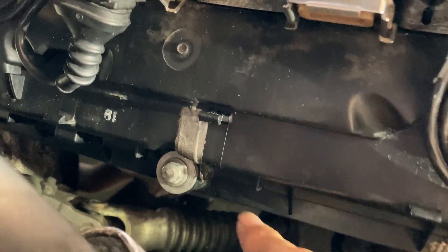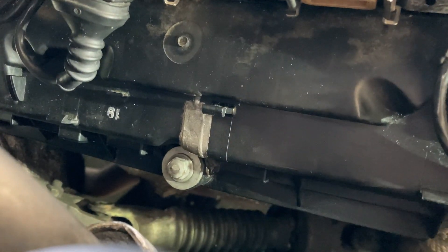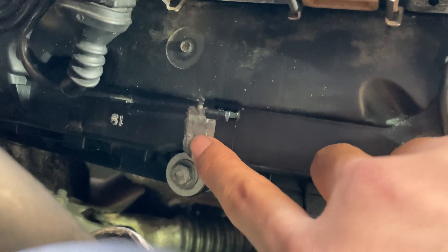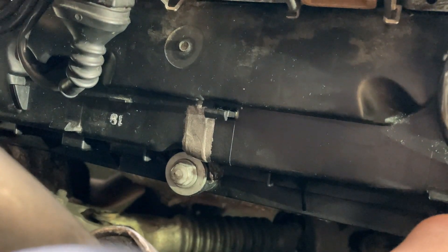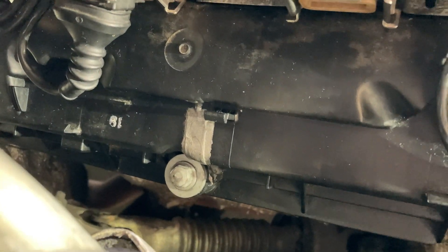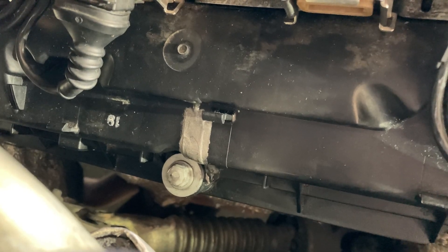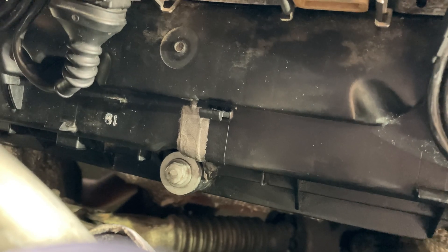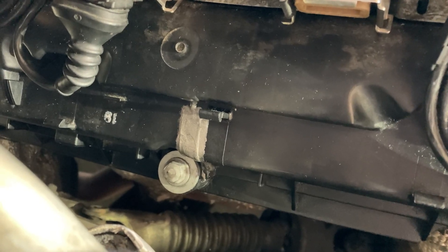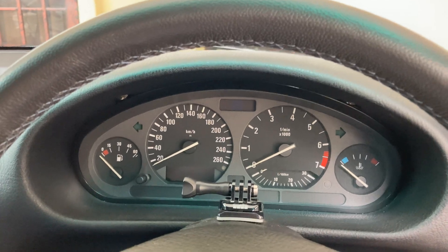This is the outcome — I tried to do it as neat as I can. The crack developed from near about here all the way down to the rim. I've just bolted the valve cover back and so far there's no crack that redeveloped because of the bolt, which is good. The texture of the epoxy is soft, pretty soft — I can feel it's a bit jelly-like even after more than 24 hours of curing time. This type of texture is what I'm looking for because this plastic has to withstand the vibrations and also the heat from the engine, so having a bit of softness in the epoxy should help withstand those vibrations.